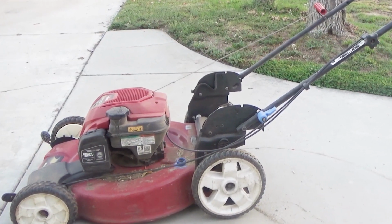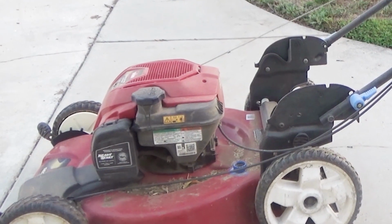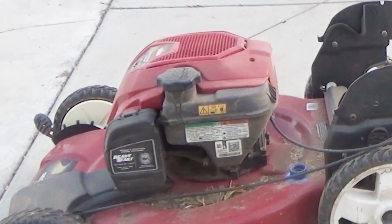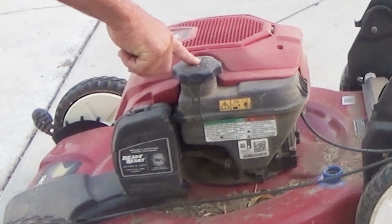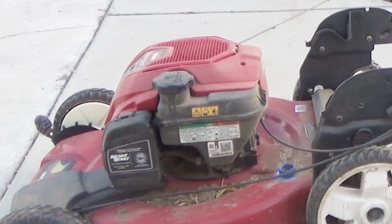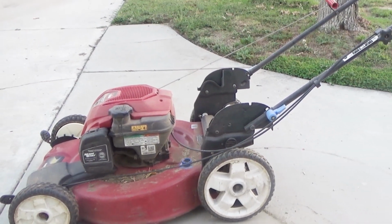I did this video just to kind of update what was going on with the carburetor, to let people know that even a few months later it worked, especially because I'm going to leave a review on Amazon about it. I had one guy tell me it has bad reviews, but I've often wondered how much of it is that the carburetor is actually bad and how much of it is people don't clean their gas tank out really well. And so it just gets stopped up right away again, and they blame it on the carburetor, where really they just need to clean their gas lines and their gas itself out and put new gas in. But there's nothing wrong with the carburetor, at least that's been my experience.